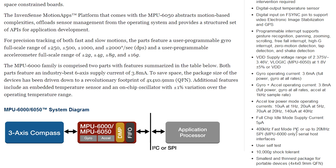It has an I2C interface up to 400k or a 20 MHz SPI as well. It's tolerant up to 10,000 Gs of shock, which sounds like a lot. But when you drop this thing onto a hard concrete or steel surface on its edge and the plastic is coupled directly through to the PCB, which is soldered directly onto the chip, you can in theory easily exceed that 10,000G shock rating and damage the device.